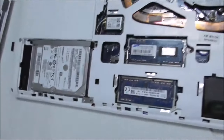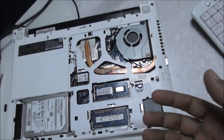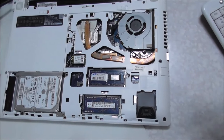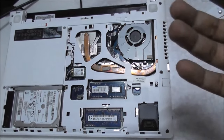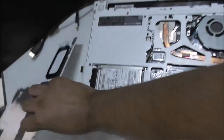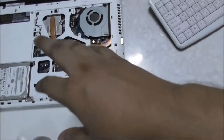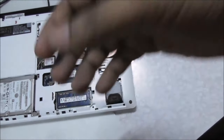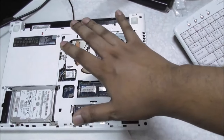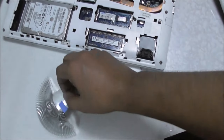So what I'm going to do — I bought this heat sink. I want to do two things. First, I want to keep the back cover off, because at home I play games most of the time. If you travel a lot I won't recommend it, but if you stay home most of the time — six or seven months at home — then I recommend removing the back cover. After bringing out the back cover alone, my temperature went down 5 centigrade, from 80 to 75.